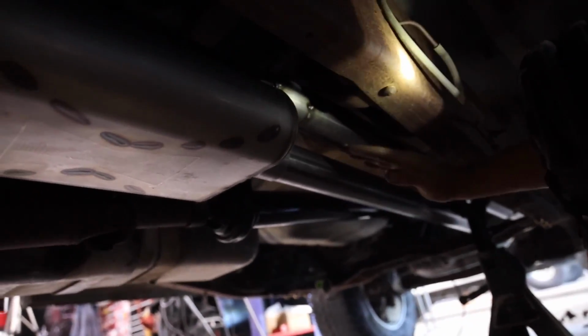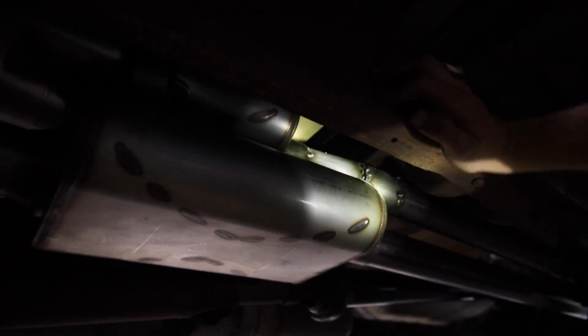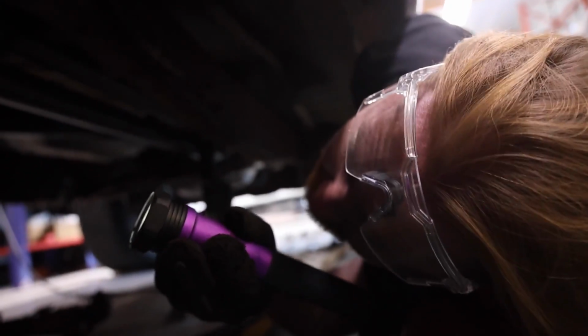Okay, so you can see there's two mufflers in there now. Can't really see it, but up here, I actually ran the other one, tucked it up. Don't look at the weld right now because I'm not done. I just had to tack it with no mask on, which is really hard. But that kind of snakes above, and then you can see I stack them. But I put exhaust hangers to keep a 1/4 inch gap in between the mufflers, so the mufflers are not actually touching, which is good. So now all I need to do is keep the system true dual. Naturally, what a lot of guys would do, running into a 2 in 1 out kind of muffler.